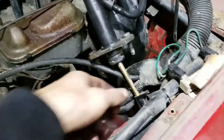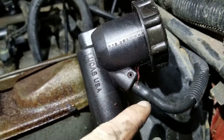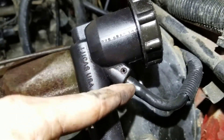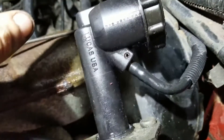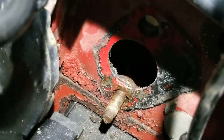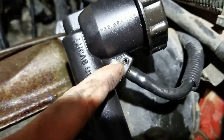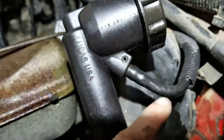I got this up out just enough so we can work on it. The next piece of this puzzle is to knock out this pin right here. This piece in the cylinder is held in just with this pin, so once we knock this pin out with a punch, it should just slide right out. A little bit of fluid may still come out of here even though you emptied it, so beware. In here is brake fluid, and over time brake fluid will eat through just about anything. You can see on the firewall where the cylinder has leaked, pulling off a lot of that paint. So if you've got one with good paint on it, be careful with this step. We have to knock this pin out with a punch - be careful not to break it since it's plastic, unless you plan on buying a new cylinder.